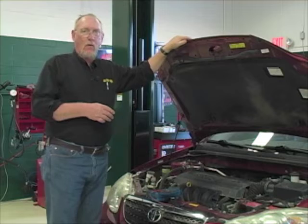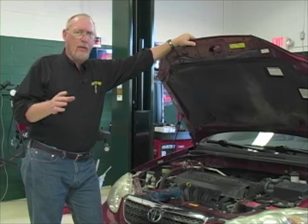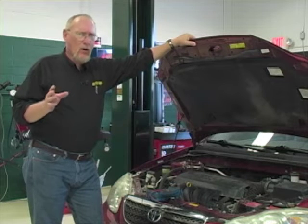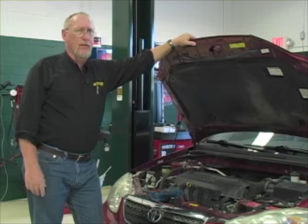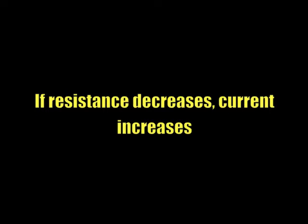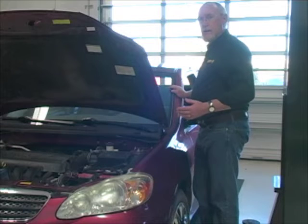The circuits in the car are wired in series, or parallel, or a combination of the two. The individual loads you're faced with troubleshooting on a daily basis can all be treated the same. Don't think of the circuit path — think of the current path, and what's going to affect it. Now, if the voltage is fairly constant, the only thing that's going to affect current is resistance. That's one of those strict rules: if resistance increases, current flow decreases. If resistance decreases, current flow increases.